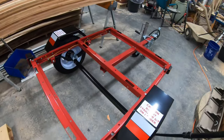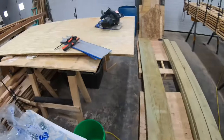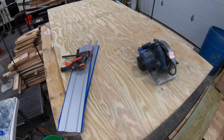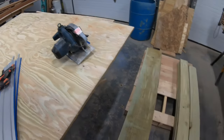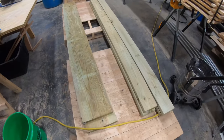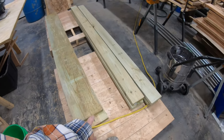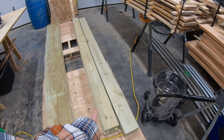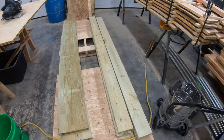Good morning, everybody. Now it's my turn to work on this trailer. I'm going to take this thing and put in this marine plywood — I'm going to cut it, double it up, and put sides around this thing using these two-by-twelves, and then separate the interior space using a couple of these two-by-sixes.